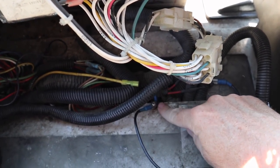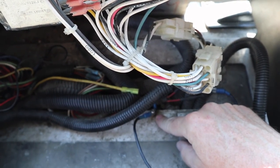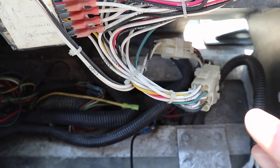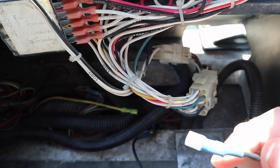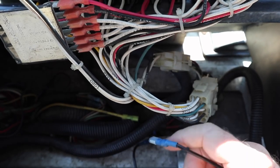I had another idea - I'd create a dedicated clean ground wire to the body of the step van. There is a ground contact here that goes into the body, and there was an existing wire on it. I created a dedicated wire with its own connector so I could do testing and bypass the existing wire harness with my own ground wire going to the frame. Then I went for another test drive - no change at all, the problem still existed with the exact same behavior.